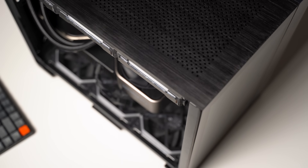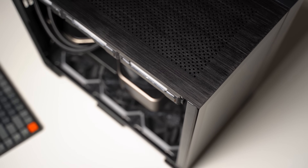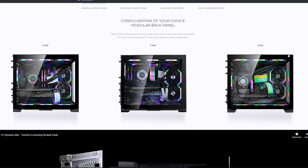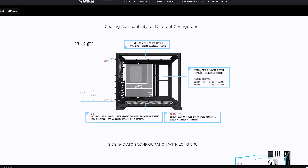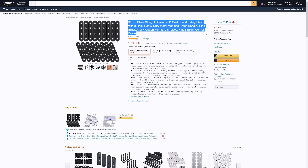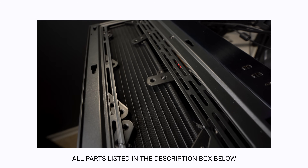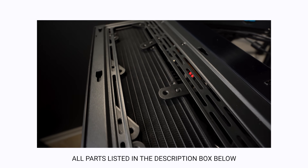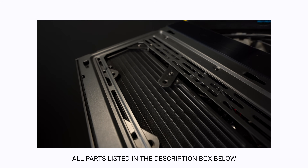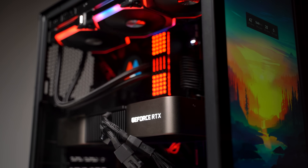All of these parts are installed in this beautiful all-black Lian Li O11 Dynamic Mini. This case was super easy to build in, but it doesn't officially support a 360 millimeter AIO up top when using an ATX motherboard. So I had to get a bit creative — I ended up ordering a couple of brackets off Amazon and zip-tied the AIO up top as a workaround. It's a tight fit and surprisingly stable, but watch out for RAM clearance if you plan on doing this. Big shout out to the Poet for this idea — I'll leave a link in the description to his original video.